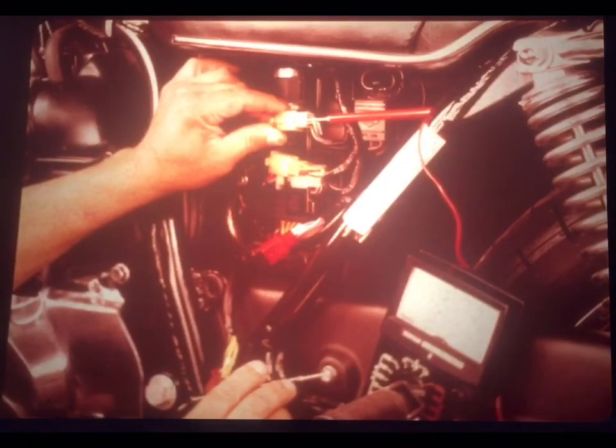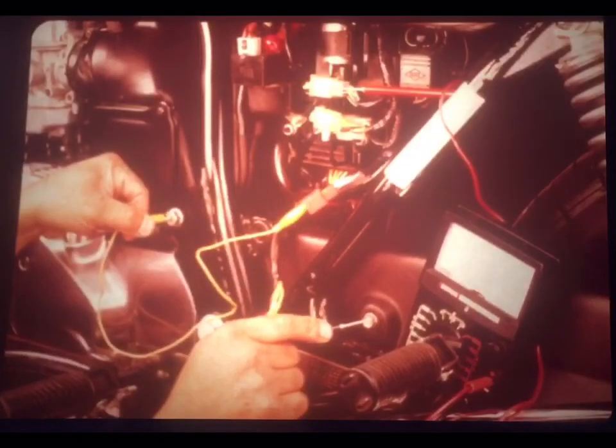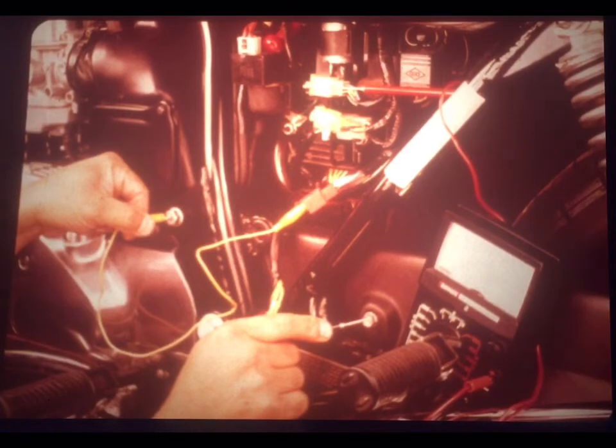At the spark unit connector, Joe shifts his positive lead to the wire that comes from one of the ignition coils. With no ground wire connected, and with a pulsar coil connector still uncoupled from our earlier test, the spark unit thinks that it's not receiving a pulse to close its switch. The switch is normally open, and Joe should be able to measure battery voltage in the primary from the coil. Do understand the voltmeter creates an alternate path to ground for the primary circuit, and that's why we're getting a reading here.